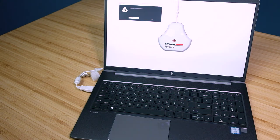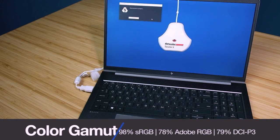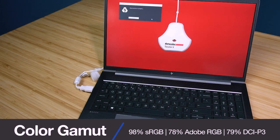According to my test, the HP ZBook Power with the Ultra HD display can reach 468 nits at full screen brightness and has a color gamut range of 98% sRGB, 78% Adobe RGB, and 79% DCI-P3. The color gamut range is solid. However, the color accuracy comes in at greater than three. So it has some good color gamut range, but this isn't exactly optimized to be very color accurate, at least out of the factory. You might be able to buy an aftermarket DataColor SpyderX color calibration tool to help. The brightness was noticeably brighter than most laptops I have in my studio — I actually had to turn the brightness down.